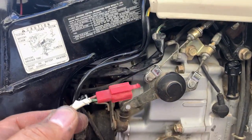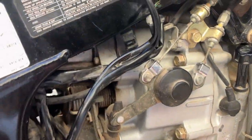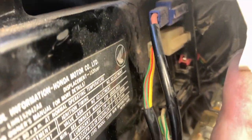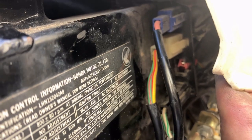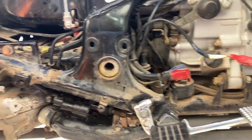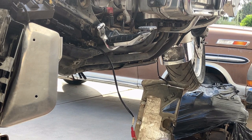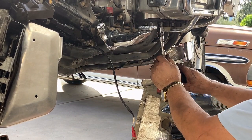You'll have to pull this bolt right here that holds the seat in and kind of move this cover out of the way to get this wire unplugged. In my case it's a red one — the one I got was blue — but just trace it down. There are a couple of little clamps holding these cables together, and there's a little holder for those connectors. If you pull this back a little bit, you can pull on the connector from the back side and it'll come right out, then push in the clip to pull it out of that connector. That's all we've got left — just that line — and we'll see if we can't get that cylinder out of there. Looks like we're going to have to pull this exhaust loose after all, because there's just no way to get that other line off.